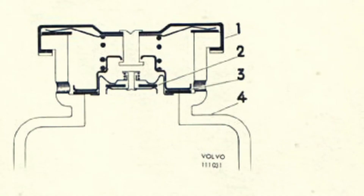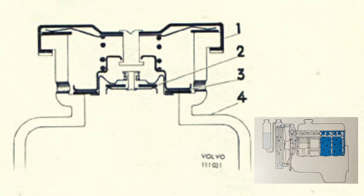When the cooling system cools down, the volume of coolant is going to contract again. For this function there is an anti-vacuum valve. In this picture you can see the anti-vacuum valve, marked with number 2. The coolant is automatically drawn back into the cooling system to maintain the correct level — coolant is saved and reused. This valve lets coolant come back to its correct level when the system cools down, relieving the partial vacuum that would otherwise occur.